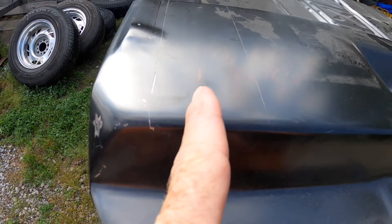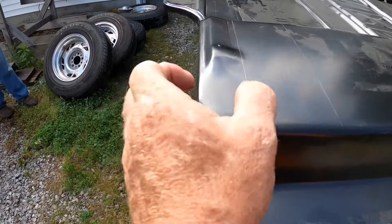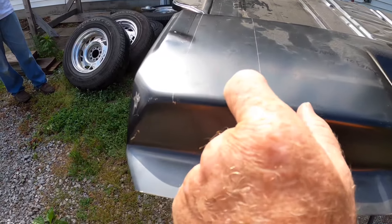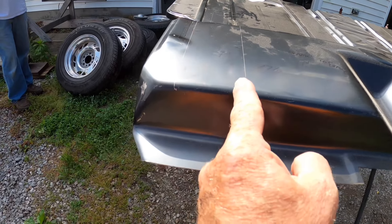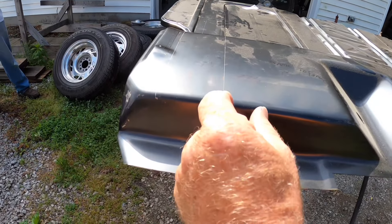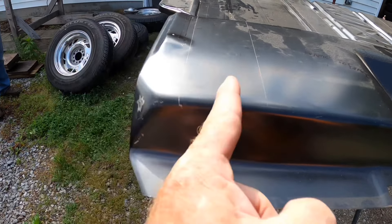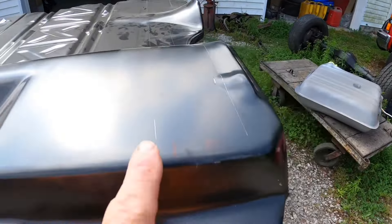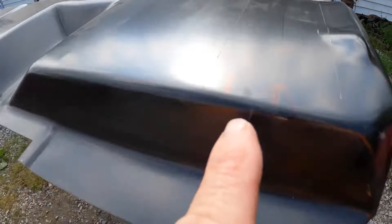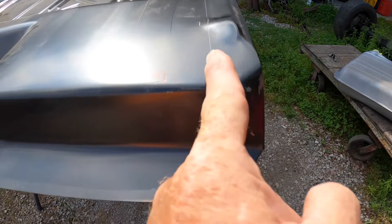We marked it right here, then set out from where the frame rail sits and went in an inch and a half, because we want to put this flange back on where we cut it. So we're going to cut this out an inch and a half and put it back over to where the frame rail is. When you put this section back on, the flange here will line up with the frame rail - it'll look like an original flange but just narrowed. Same on this side. We scribed our line at the frame rail minus an inch and a half.